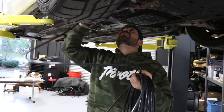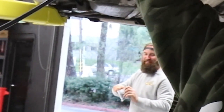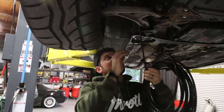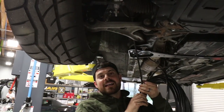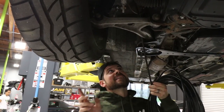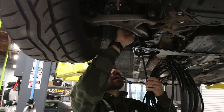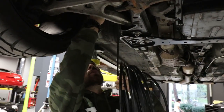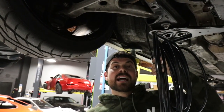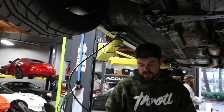What I'm really focused on here is making sure we run the airlines away from any moving parts and anything that creates heat. We've kind of mapped it out and I'll show you guys once we get some progress — where we're going to run the airlines to ensure we don't have any leaks or any potential reliability issues.